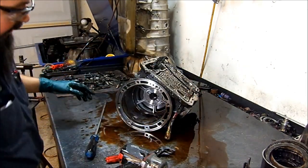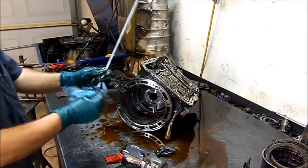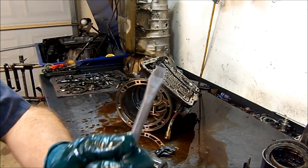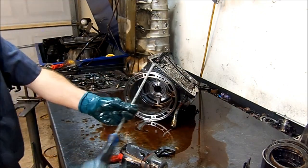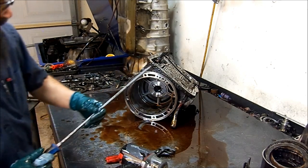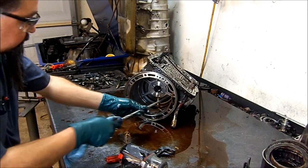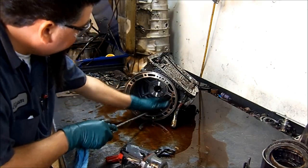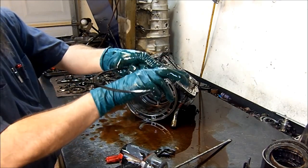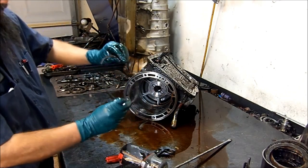Get this band anchor assembly out of the way. Now we're going to remove the snap ring. I have a screwdriver with a little notch cut out to hold snap rings — you can get one like this at AutoZone or any auto parts store and use it as a special tool. The snap ring here is flat on the bottom and beveled on the top. The flat part goes towards the center support and the bevel goes up. Point it at about 5 o'clock because you want to clear the wire for the turbine speed sensor.